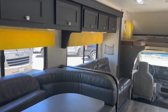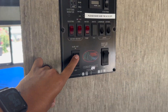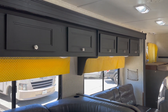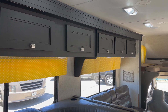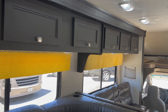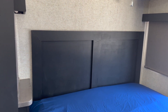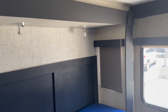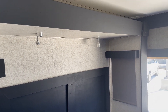In this RV you have two slides. For the main living room area, the control for the slide is on the control panel here. If the keys are in the ignition, the slide will not go in or out — it'll be locked in place. Make sure no one is sitting on the couch and everything is clear all around before you bring it in or out. For the bedroom slide, the control is on the wall — hit retract and the slide will come in and stop on its own. Make sure no one is laying on the bed when you operate it.